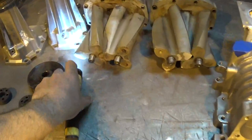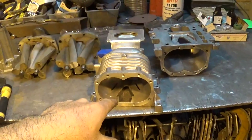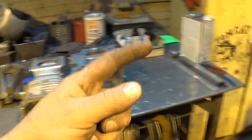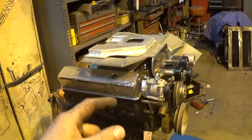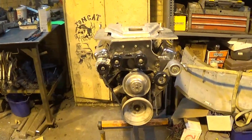Super easy to pull apart, we might as well find out. In the future we'll go to the later model bearings with the seal anyway. I'm trying to get this thing running so we can take it down and do some burnouts next month. So that's pretty much what we got to do with the superchargers — rebuild the snouts, get them ready, clean everything up, get the porting done on the bottom, plug the silencer holes, and get those things ready to run on the engine.